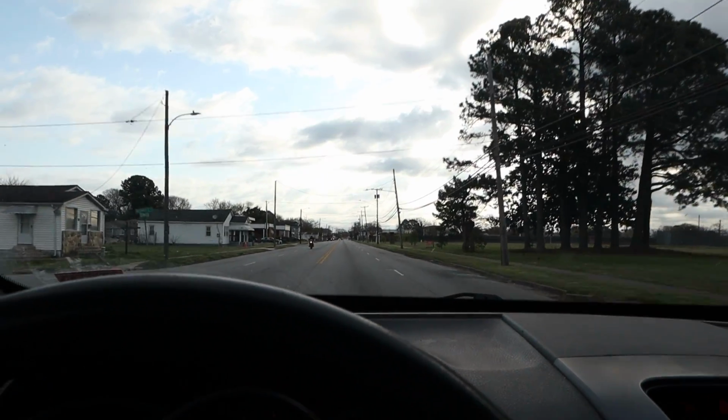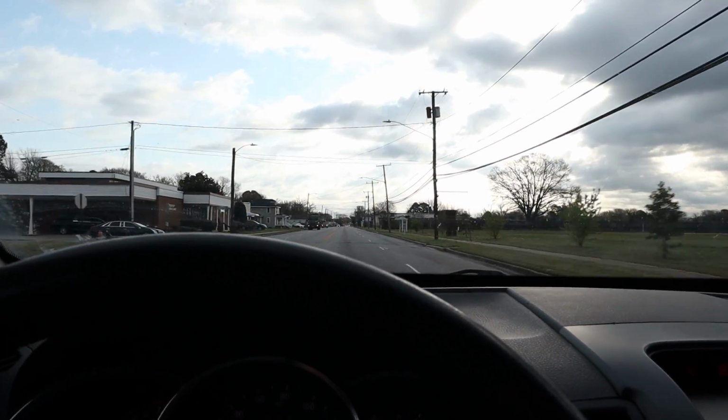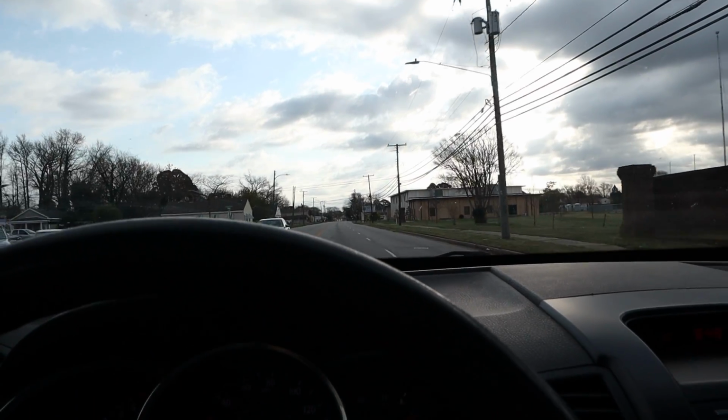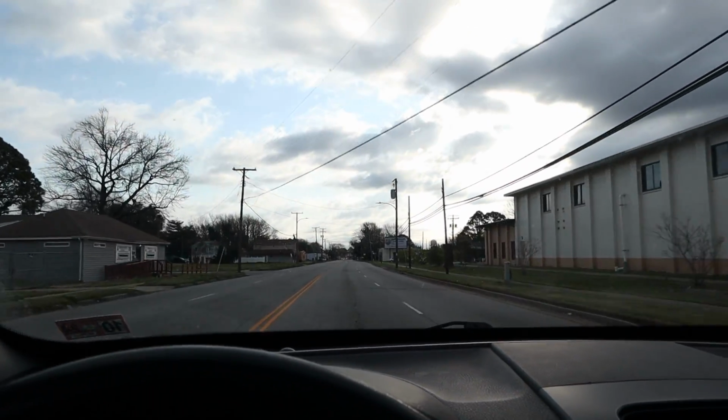All right, I had a customer drop off a 13 Kia Sorento, and she was saying going over bumps the steering feels kind of funny, and when she hits the brakes, the car wants to jolt one way or another. I don't feel the jolting, but I do feel the steering. It almost feels like lower control arm bushings, to be honest with you.